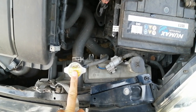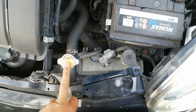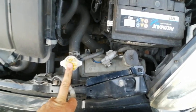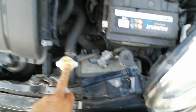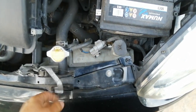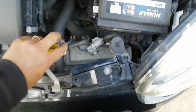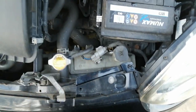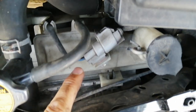Normally hopefully we won't touch this, and you can see it says caution on the top. Do not take this cap off unless you've spoken to someone who knows what they're doing. If you're not sure, do not touch this cap, especially if the car is hot or you've been running the engine. If these pipes are warm and the engine's warm and you've been out running the car, this can stay pressurized for many hours afterwards and if you take this cap off it will spurt up high pressure hot water and will probably scald you. This is not where we're going to fill the water up.